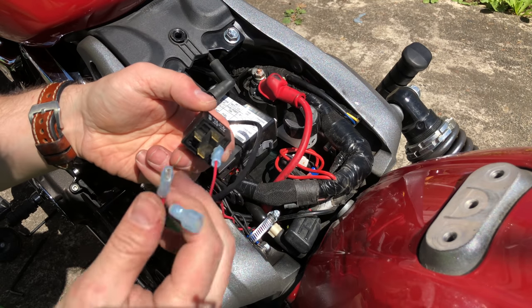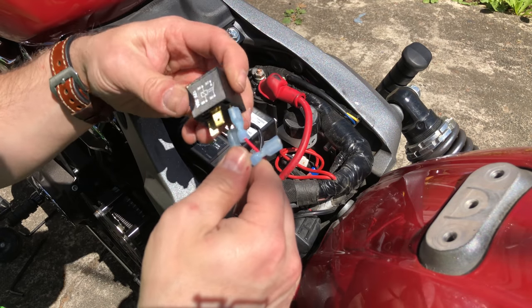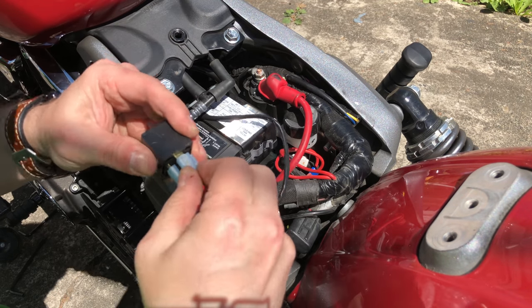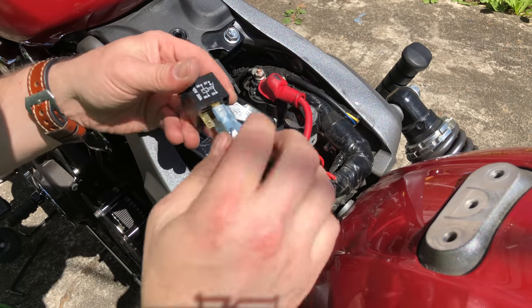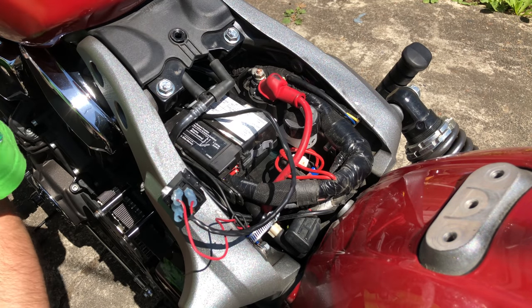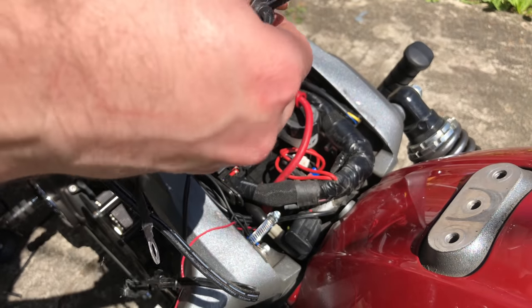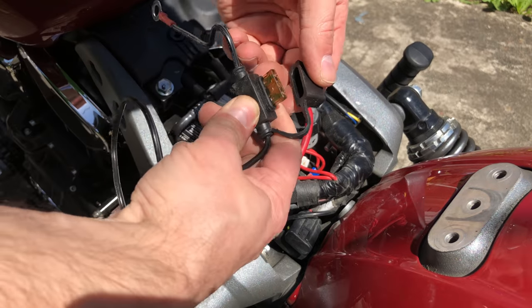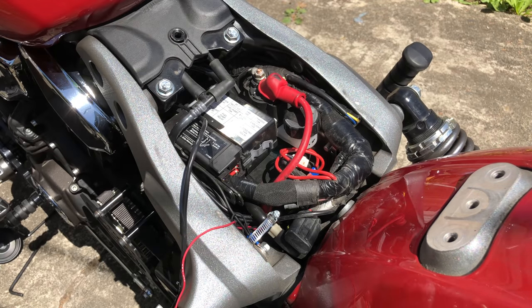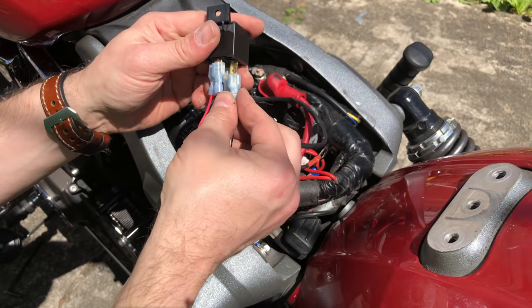87 and 30 — okay, 85 and 86. This relay is set up a little different than most relays, it's rotated and it's throwing me off. I'll pull it off and rotate it. Final connection will be battery power and then we'll have a working, freaking loud horn — Sound Bomb. I've got a spare pigtail for a battery tender that came with a 7.5-amp fuse in a nice fuse holder, so I'll cut it here and use that as a positive feed to the relay.